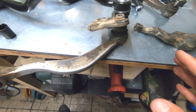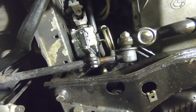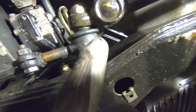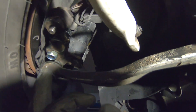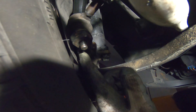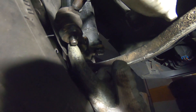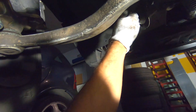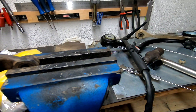Full lock to the left and I still have some space here, but I don't want to push it too much because when the suspension is compressed you can touch the top. What I can do is change the Ackermann a bit inside so the wheel turns a bit more outside, and when it turns inside it doesn't touch.